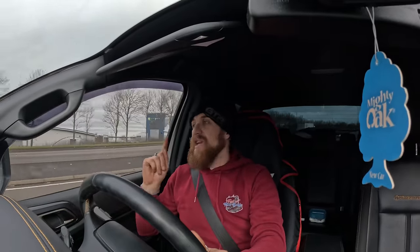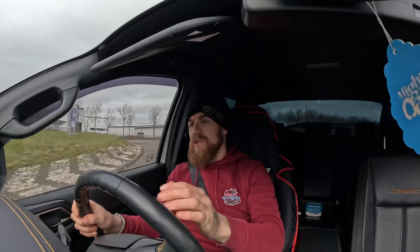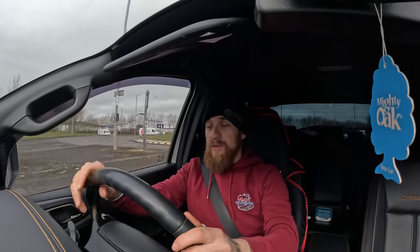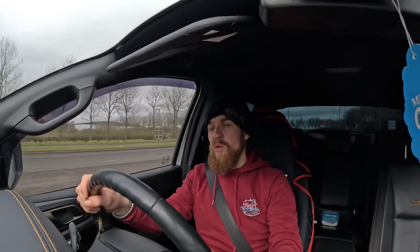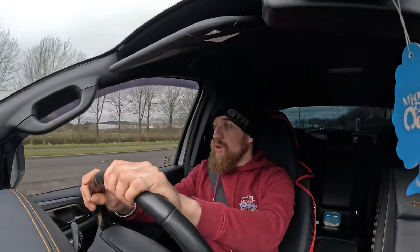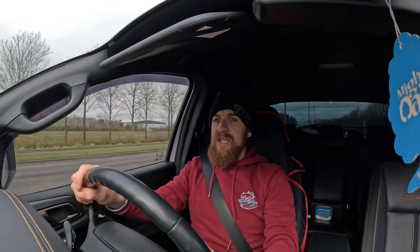So lucky and relieved — it is the two heater pipes that run to the AdBlue system. I'm just going to buy the bracket — it's £185 from Scania plus VAT. Ouch. But it's a lot better than rebuilding an engine.